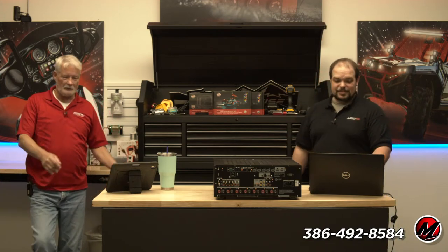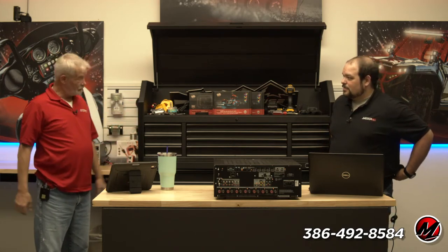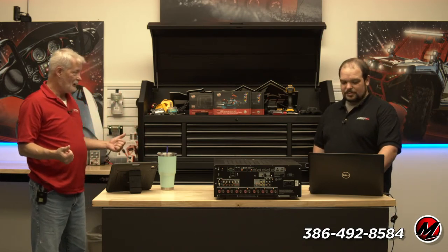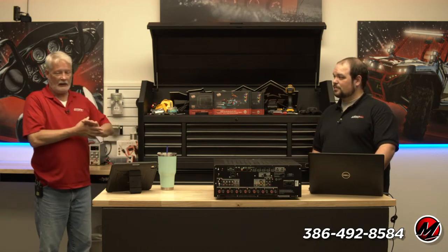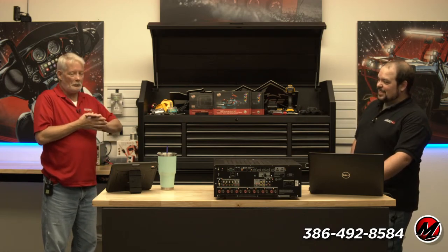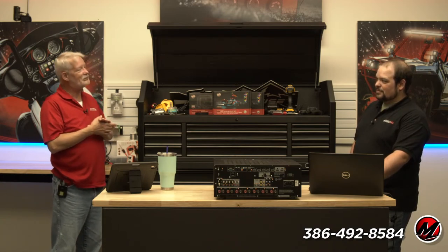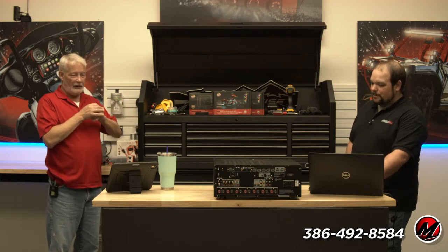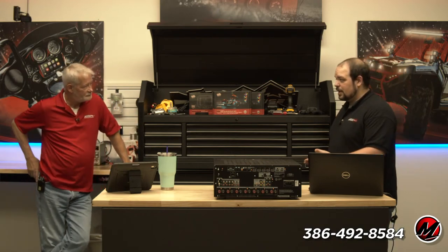We have an episode coming up on HDMI 2.1. Don't get caught up on it because there's still a whole lot of unknowns. There have been some issues with products that have the 2.1 chipset — we have found that they do lock up, and the only way to unlock them consistently is a power cycle. It's not a hot plug on the HDMI; it's a full lockup of the processor in the AVR.